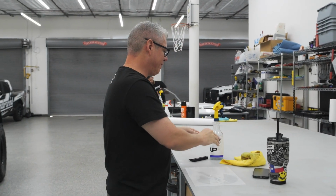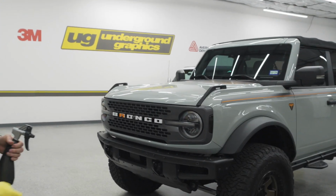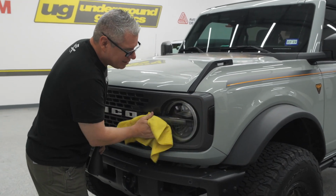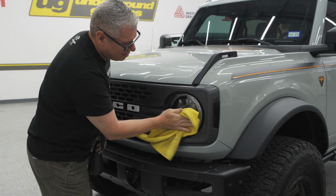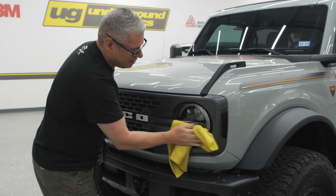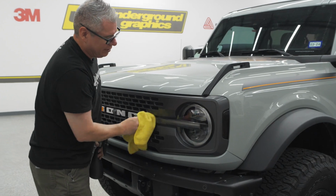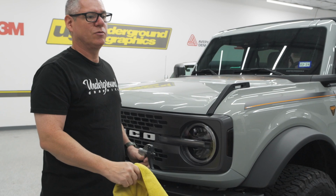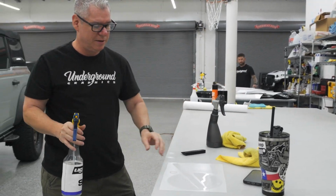With all of our PPF, make sure that area is clean. I just pulled that off, but use that alcohol water mix and a clean microfiber rag. Just spray that on there. Make sure there's no bugs, no dirt, nothing on there. And again, when we apply PPF, it's always going to be soap and water. Typically, I think it's 6 to 8 drops of that Dove. We like the Dove soap mixed in with water in a 16-ounce bottle. We should have some of that on the site soon as well, but that is the formula. We've got some soap water mix in here.